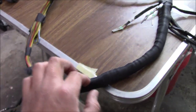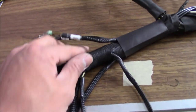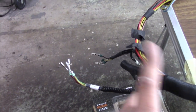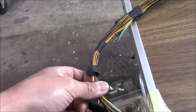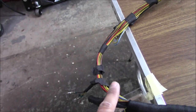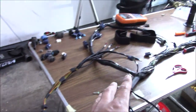One of the good tips I can give you is to do section at a time. Everywhere you see new transitions or new branches, just stop there. I'm going to leave this section, shrink wrap this, and this back portion is kind of done. I might throw another piece of shrink wrap right here to try to cover this little slit so it doesn't get bigger, then a piece of shrink wrap right here to cover this transition so these guys can branch off. This section is a little thinner, so I might use three-eighths split loom to cover it.